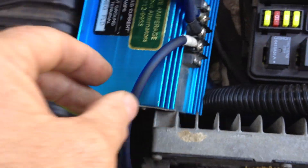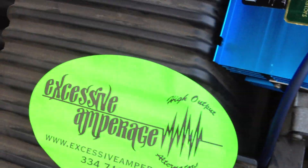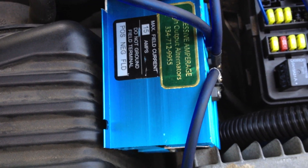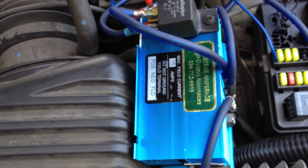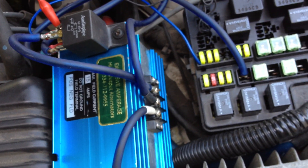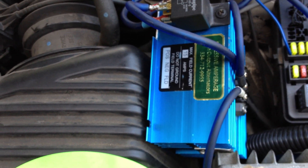The last one you have left is your field wire, which is right here. Your Excessive Amperage alternator is going to have a wire coming out of it — that's where this wire goes to. The wire coming out of your alternator, you want to run to the field terminal on your Excessive Amperage external regulator. I recommend using between 12 and 16 gauge wire, depending on how far the run is going to be.